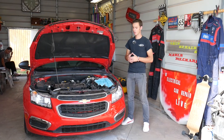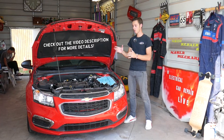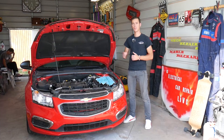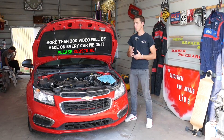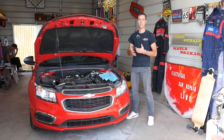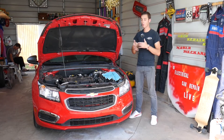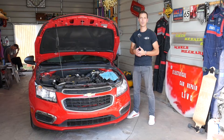So where is that sensor? You have two sensors that collect data for the air temperature. One is on the bumper and one is on the engine. That one on the engine is more important because that sensor actually determines how much fuel to spray and a few things that mix together to actually form the mixture, so that the engine can run the best and pollute the least.